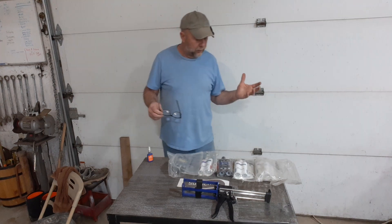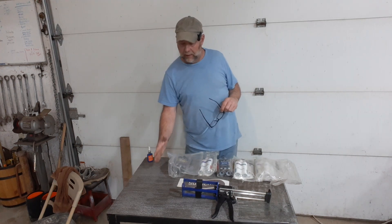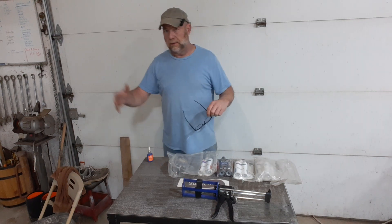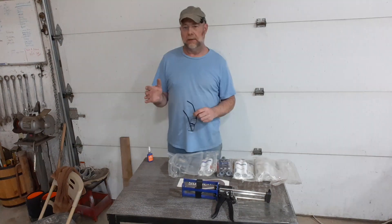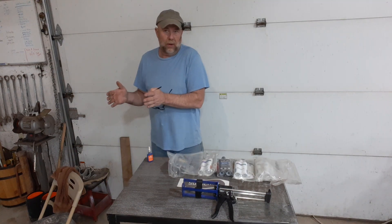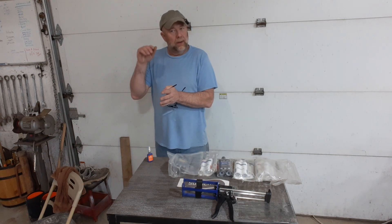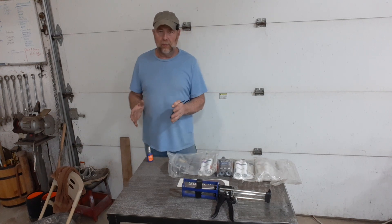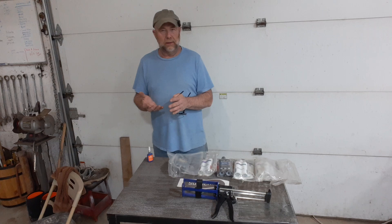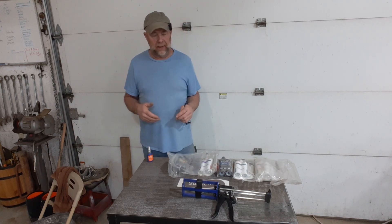Those dry out, they crack, they come apart — it becomes a problem. So there's many ways to do it. Regular seam seal or caulk or silicone, all those things work, it's just a shorter amount of time. If you use regular house caulk, it'll work for a year or two. Even though it says 35 year on it, it will shrink and cause water to leak in there. Same thing with regular silicone — if you have water just standing on silicone all the time, it will tend to peel away a little bit and the water will find its way past it.